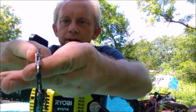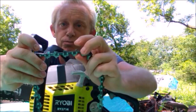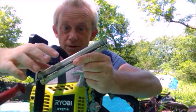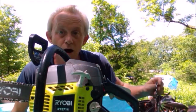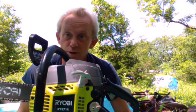What I noticed was there's a blade on each side — one angled one way and one angled the other way. You sharpen from one side, then switch sides and sharpen the other side. The problem was I think one side of the chain links is smaller than the other. One side holds in the guide very well and you don't have any problem sharpening it, but the other side doesn't fit right. I was taking the file out of the guide and manually doing it, but the chain was still going dull within the first tank of gas. Then the other day I hit a rock — I'd hit rocks before and been able to sharpen the blade right back to new — but this time I sharpened it and it wouldn't sharpen. I tried three times and it just would not cut wood. It was smoking and burning the wood.